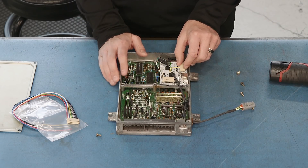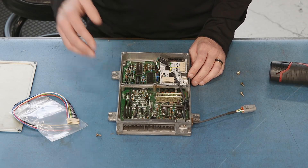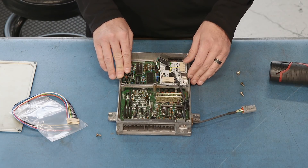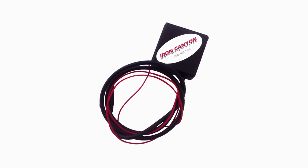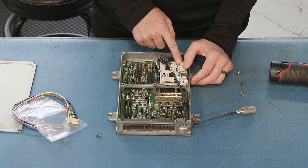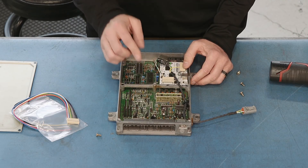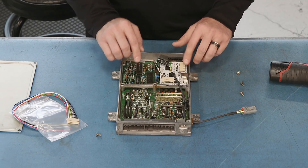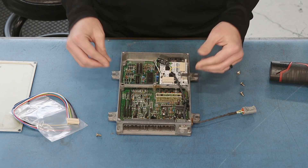The yellow wire on here was utilized for fuel level, as the car has a converter module that outputs a 0 to 5 volt analog signal. We sent that into the Hondata, which then sends it out over its CAN bus network so that we can see that analog voltage on our CD7 and configure the CD7 to display fuel level.